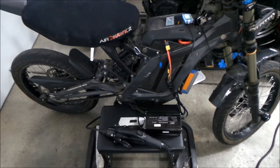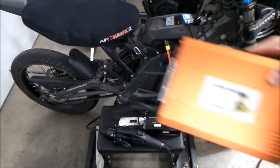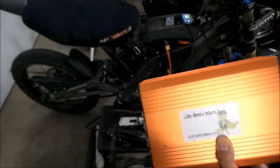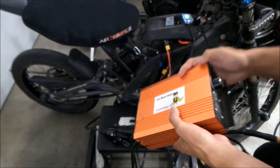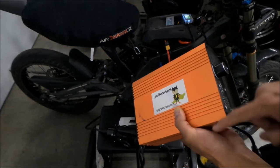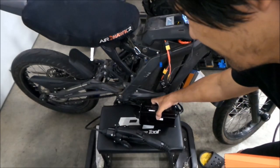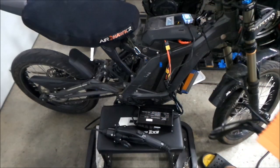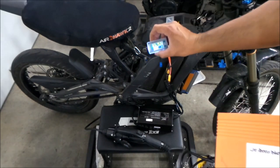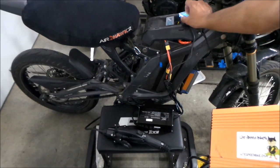Let me see. So why, Hades Omega, don't you use the Lightspeed Bikes charger to charge your bike using this guy? Well, look at how big it is. It's huge. Okay? Look at the difference in size. Much bigger. Now this can output 12 amps, but I wouldn't do it for very long. It gets really hot. This works at 10 amps, and it looks like it's not heating up that much at all. Maybe we should come back in like 10 minutes to see how it is. I will charge this battery up to like say 70% or something, like 80 volts or 78 volts or something.